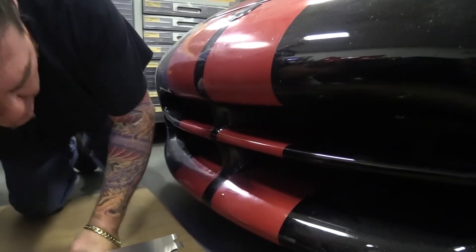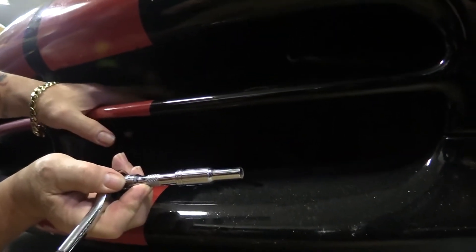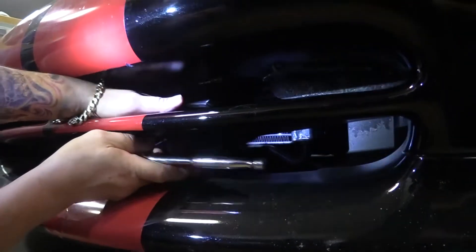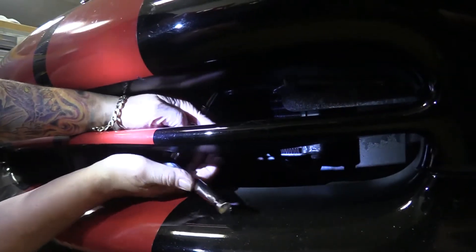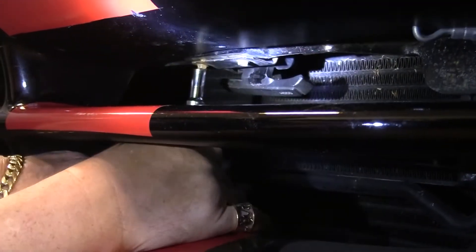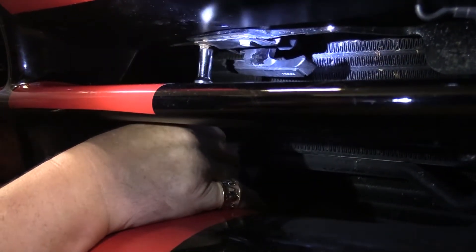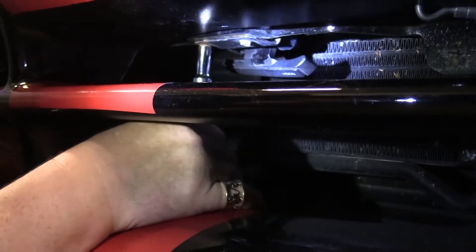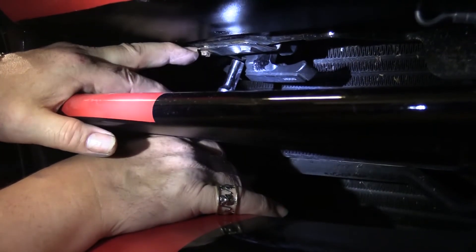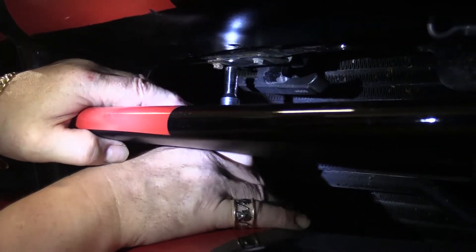Now, what you need to do is loosen a couple of bolts. In this opening, there is the release lever for the hood, and we're just going to loosen these up — you don't want to take them out, just loosen them. We'll use a 5/16ths ratchet for that. After you loosen these, make sure you have enough space for your bracket to slide underneath the factory bracket. Right in here you'll see that you've created a gap, and our new bracket is going to slide right underneath that.